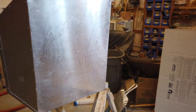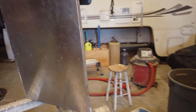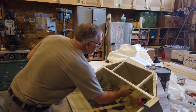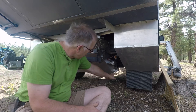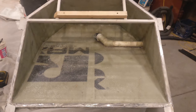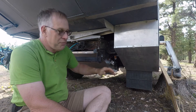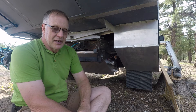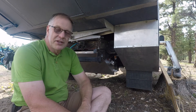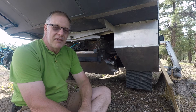It's not perfect — I overexpanded and made it a little bigger than I probably should have, but I'm happy with it and it works well. The fiberglass went together pretty well. The pump fitting picks up right at the bottom from the drain port. When the tank is full, the entire pump will be flooded since it sits below the water level, making it easy to prime and start. It will also chop up anything in it. Women's long hair has been a challenge, so the pump is accessible on the outside for disassembly and cleaning. Eventually it will get an insulated cover to protect against rocks.